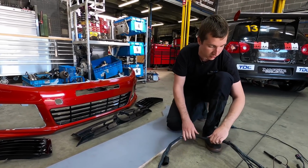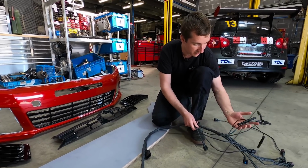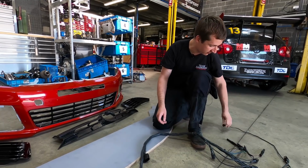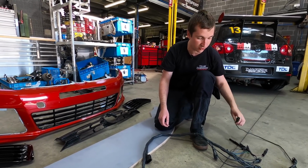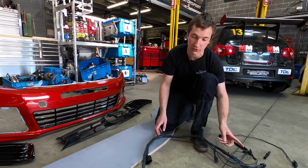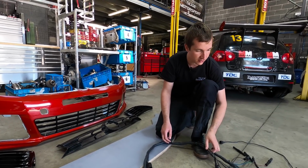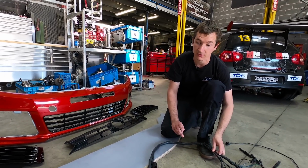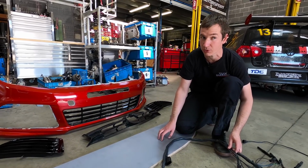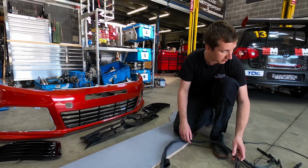The engine doesn't move about too much, but it vibrates a lot. So hopefully this will work. I'm sure there'll be people who do wiring who are wincing at this, saying they'd have done it X, Y, Z, but this is what we think will work, and we've solved a couple of problems that we potentially could have had before. One of the plugs on the regulator gave some grief at the last track day, if you want to watch that video. It gave us the same symptoms as running out of fuel, which was frustrating because it seemed to always do it when it was low on fuel, but we did have it happen once when it wasn't, so that's how we isolated that problem.